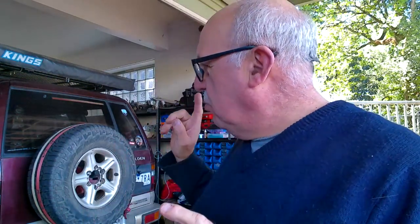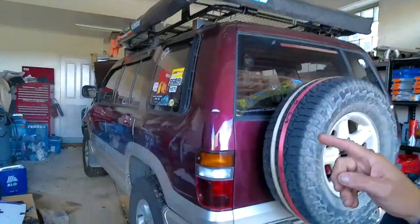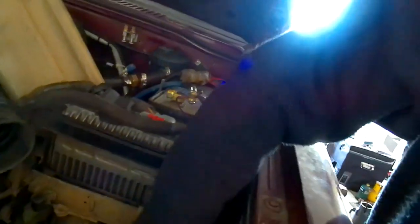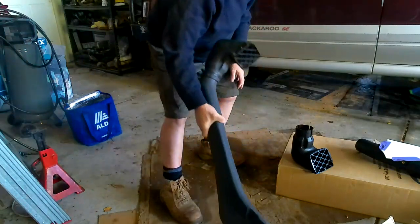I'm in the middle of doing the job - I can't get my hands in behind and I'm waiting for Rob to come and help me. What I have got is the car in pieces. Here's the hole ready for the new snorkel to go in, and the air box has been removed. You can see the access down there to get into the wing. One important thing: remove those clips off the air filter box housing before you remove it, because they'll fall into the engine compartment and you'll never find them.